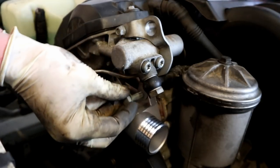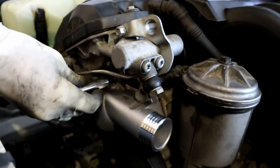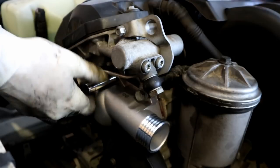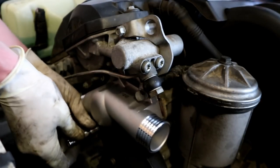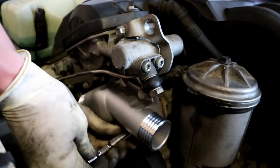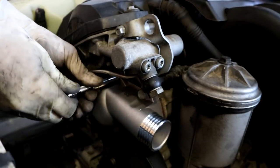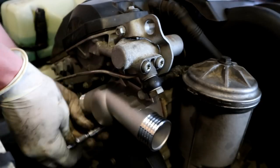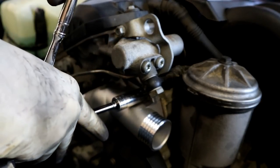And then you gotta sort of find out where he wants to sit. So I'm gonna start with a 13 that holds the engine lift bracket on. And then we can go after our 10s. And we'll go after our bottom two. And then once they're all kind of run down, I'll just go ahead and tighten them all up in a star pattern with your fingers, just to sort of lock the gaskets down a bit more. Then I'll snug them with a quarter driver.